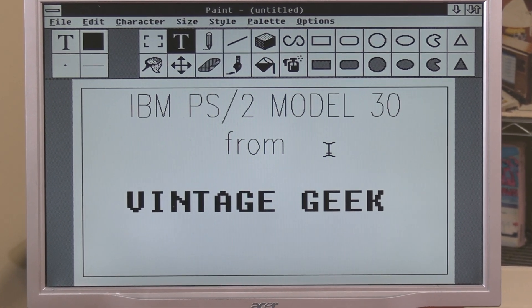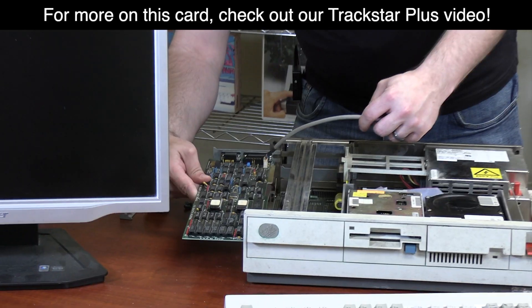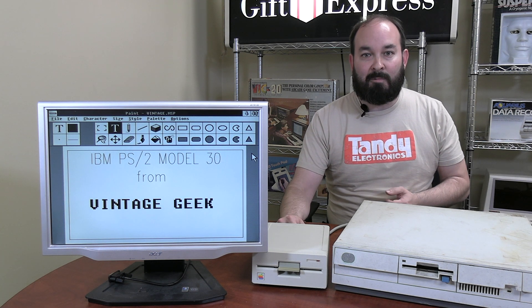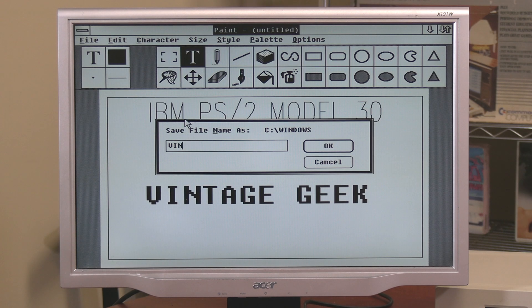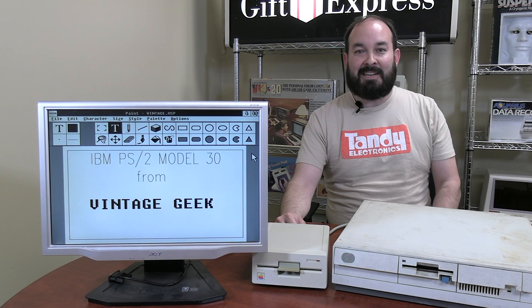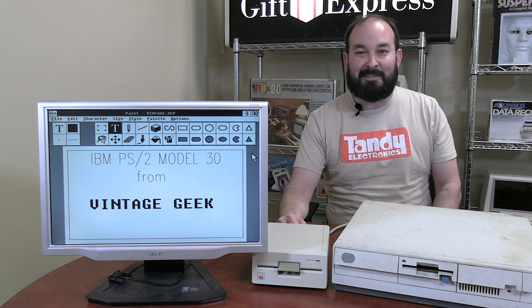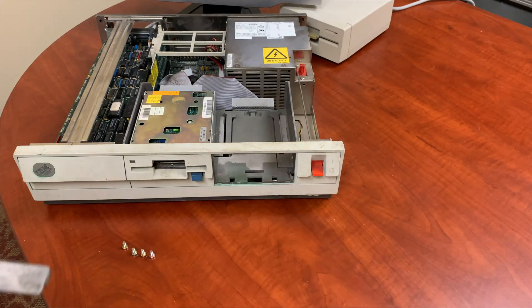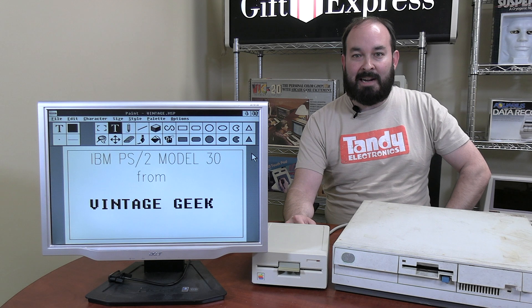It's been a lot of work, but we now have a working Model 30 IBM PS/2. Not only that, we have the TrackStar card installed — which was covered in another video — and we have Windows 2.03 installed, along with an original IBM PS/2 hard drive that is functioning, albeit with a few bad sectors, but working pretty well to run this old version of Windows. This machine is now ready to be placed into the museum. Thank you for watching us go through this process — it's been quite a few steps, quite a bit of fun, and it brought back a lot of memories doing old installs with Windows and trying to get hard drives to work. If you like what we're doing here on Vintage Geek, make sure to like and subscribe, and tune in for more videos on the channel.